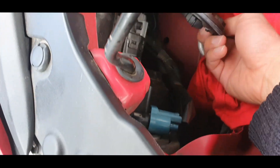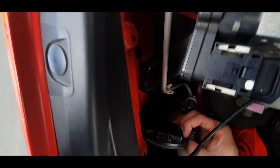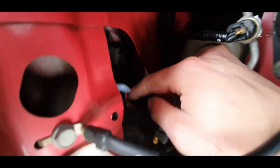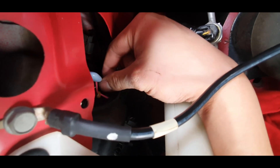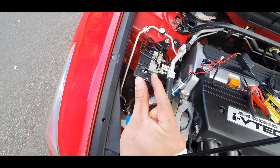To give you guys an idea, it will sit just inside here. And then you should see the little hinge on the side — just like that — so that is where you need to go. Just here where those cables are hanging out, it'll be in there. It'll hang like this and you just need to push it down to get it out. Once you've taken this out, put it aside. You will see the bulb inside. There is a little wire in there — to remove this, you need to lock it in and push it out. This one would have to be pushed down and then pushed out — down and out. It's like a four-connector clip. Press it, then down, then release it out.